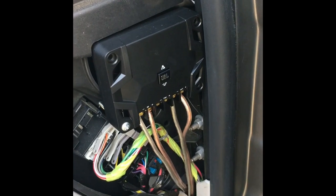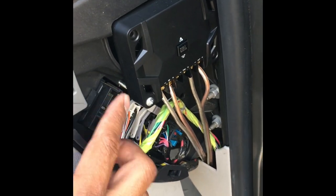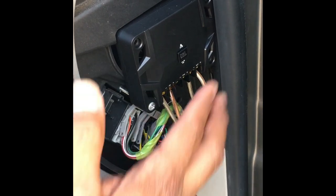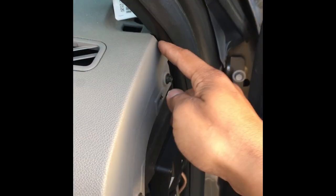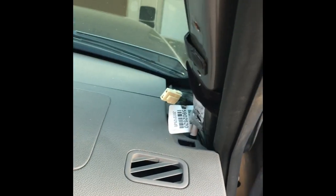And it goes around this panel here. There's the crossover on the other side — see how it sits right there. I just got a screw and it goes into that plastic right back there and holds it right in place. So once again the panel will go up here, the speaker wire will run right through here, I'll feed it through, and I'll just connect the speaker to the crossover — and we're set to go.